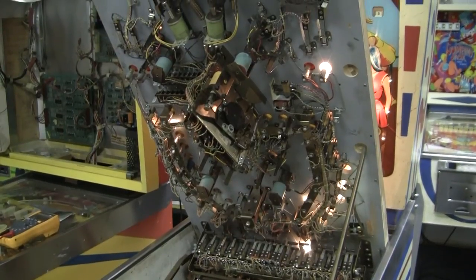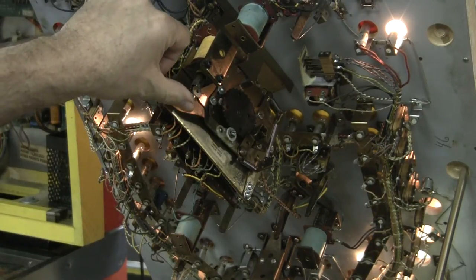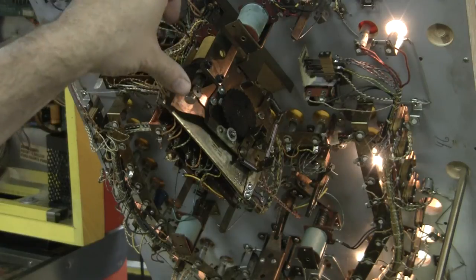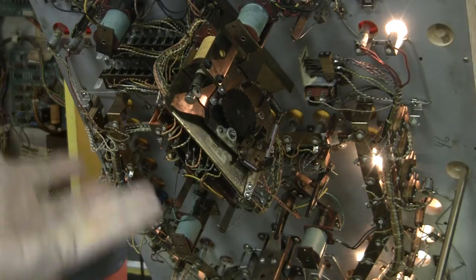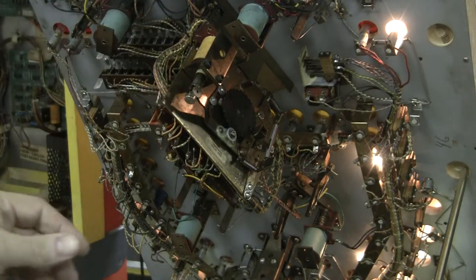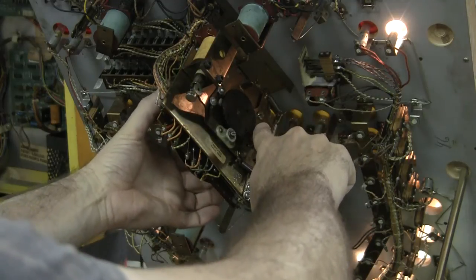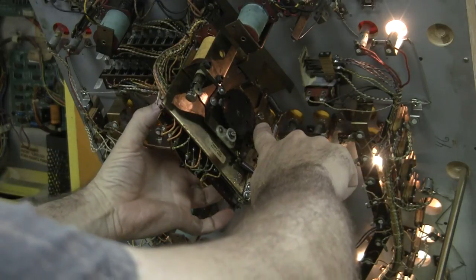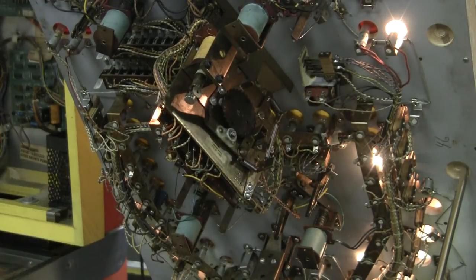I'm going to run through a few little things on the underside. Those arrows that indicate which shot is the 300-point shot — that's coming off of this relay right here. This is a continuous stepper relay. There's a disc on the other side which determines which lights light up for the 300 points. This was getting a little sticky and gunky. What I did was I sprayed a little bit of PB Blaster in here, held a cloth underneath to make sure nothing dripped, and worked the wheel a little bit. You can see how the lights change depending on the wheel position. I worked the wheel so it was a little bit easier.